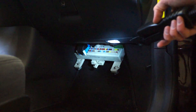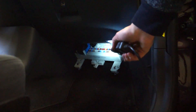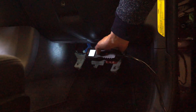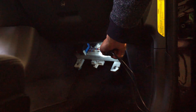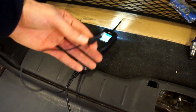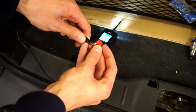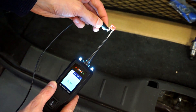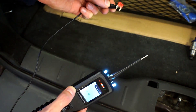The cabin fuses location in the Volvo V50 is extremely uncomfortable, so the flashlight feature is very useful. It's the first time I'm checking fuses and I can actually see what I'm doing. And even if the position is so difficult that I can't see the screen, I can still hear the beep which confirms that there's a connection to ground or to the positive side of the battery. Thanks to the additional ground lead, you don't have to check components installed in the car — you can connect a fuse to the lead and use the probe to check if there's continuity, confirming that the fuse is okay.